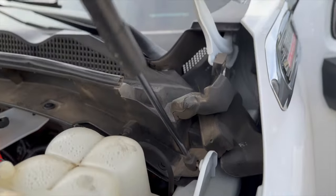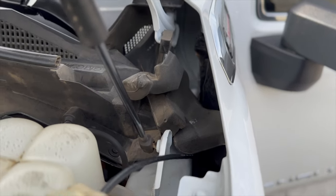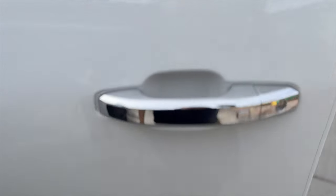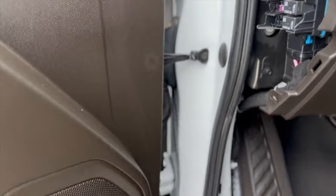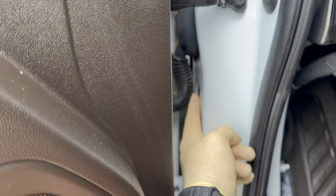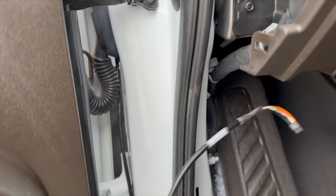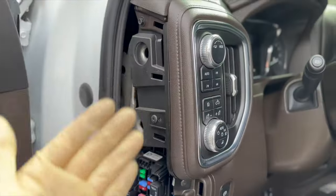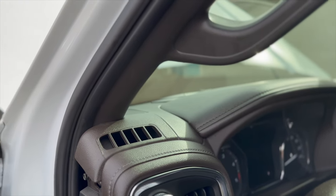This part is a lot easier. You're going to run it along the fender, in between the fender and the body. There's just a little opening and it comes down through, and then you'll get it on this side and pull it through. There is a grommet right here — Banks recommends you remove that grommet, put a hole in it, slide the connector through, and then it'll come through the body side. Then you fish it up so you can plug it into the Banks i-dash.